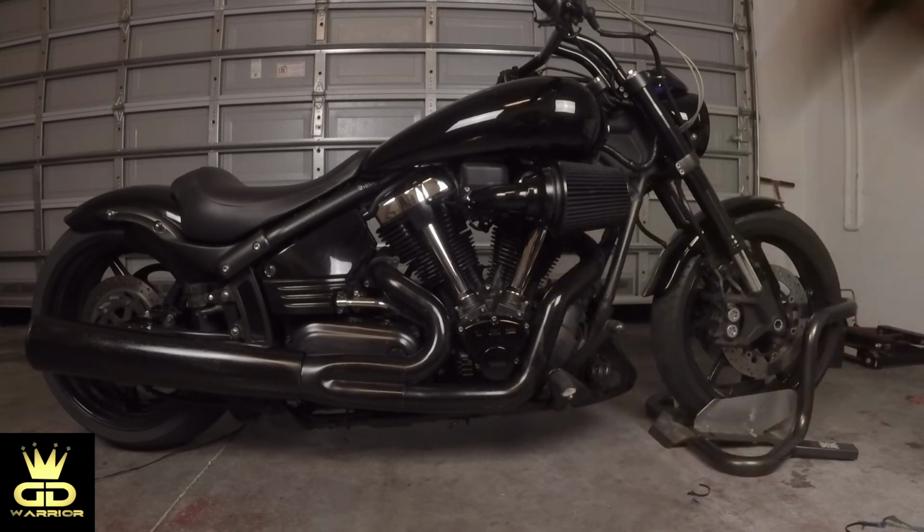Alright? Another thing to mention, when you locate your oil leak, in our case it was right here in the cam cover area, clean the area up completely so it's dry. So when you fix it and you think it's fixed and you come back in the morning and there is another new oil leak, you will know exactly where it's coming from.